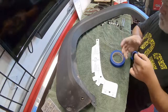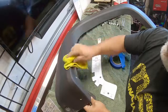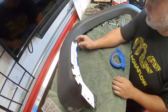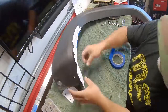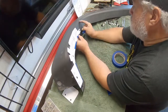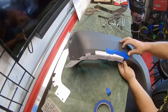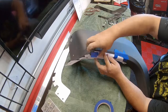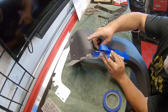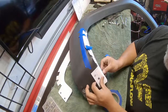Now we need to modify the plastic fender flares and line up our templates. I'll use some general degreaser to clean up the plastic so the template sticks without shifting. Spend some time making sure the template is lined up with all reference holes and on that inner hockey-stick shape that matches up to the inner edge of the plastic fender, as well as the two hole reference spots. Get everything oriented correctly and start laying down your tape to keep it from shifting.